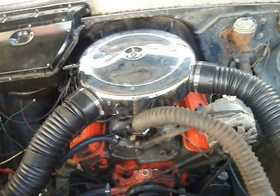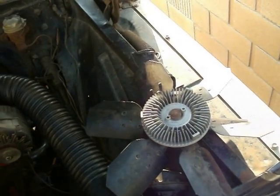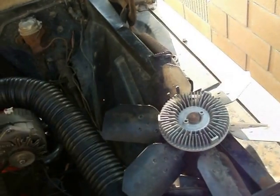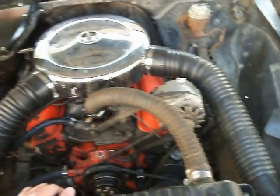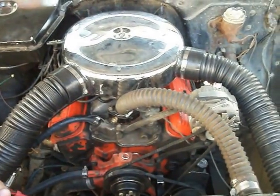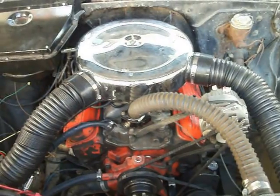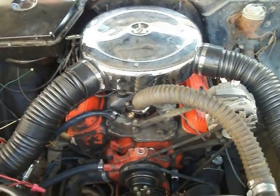Let's talk about horsepower and fuel economy. Since my old clutch fan was stuck on 100% all the time, I gained a lot of power. Most dyno tests comparing clutch fans to electric fans show an average gain of 14 horsepower — and that's if your clutch is working correctly, which mine wasn't. On fans permanently bolted to the front pulley on really old cars, it robbed about 11% power. This motor now pulls right past 100% throttle before you can blink — it never did that before. I'd estimate around 25 to 30 horsepower freed up. I didn't create horsepower, I just freed it up.